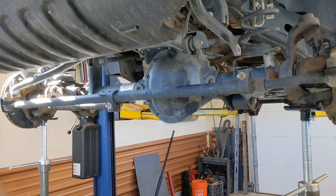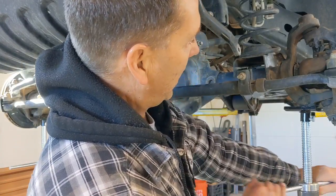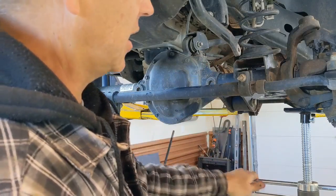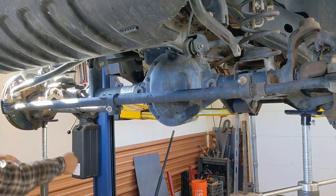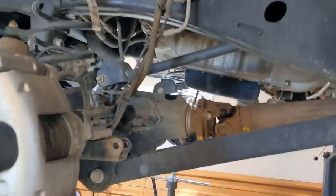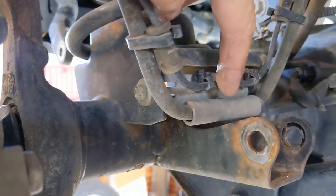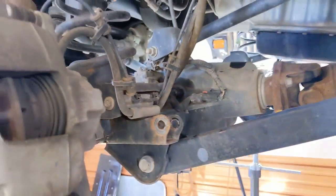Now's the time to take out the springs. If you're on the ground with a floor jack, slowly lower your axle until the springs come loose. Understand these are still under tension — that's why this is so dangerous if you don't have everything set up. Before drooping your axle, understand we've undone the bracket up here, but on the JKs they have a bolt on both sides to hold this bracket which also holds the brake line. Pull those off and pull the brake line out so you can get full droop without stressing those brake components.